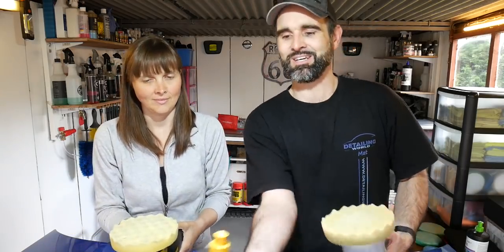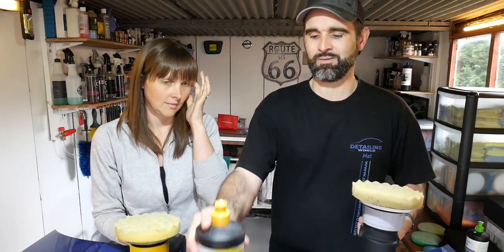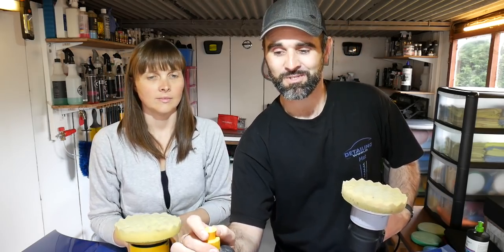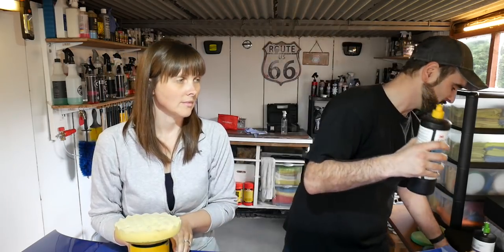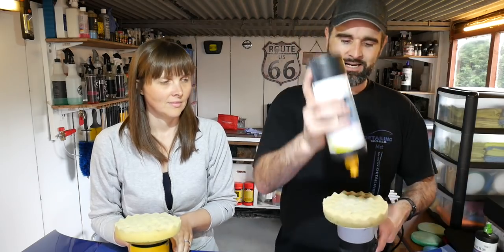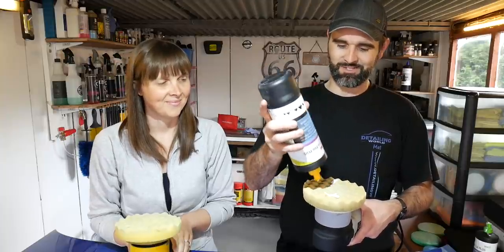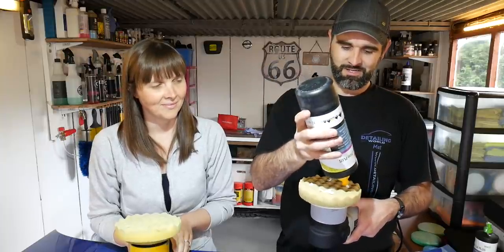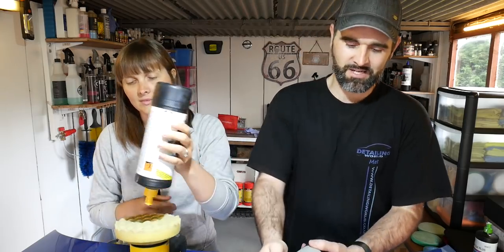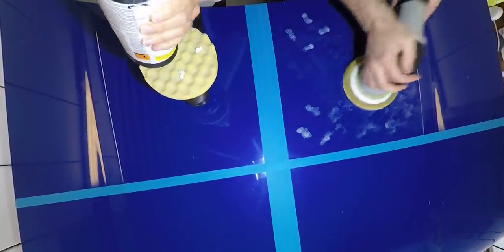Again, we're just going to give this bottle a shake. Shouldn't really be putting products or bottles on the bit you're polishing. Obviously, if it was a customer's car, you wouldn't. I'm struggling with one hand. And again, four p size amounts, garden pea size, or maybe Skittles, they're a bit big. And then you do four. I'm just going to dab mine all over. And you can feel even when you spread it, it's a softer pad than the green one that we're using.